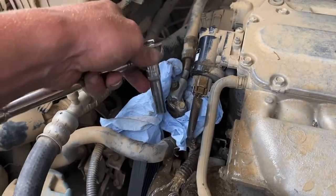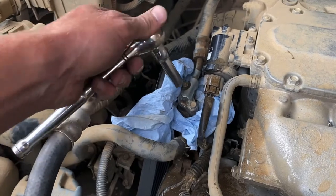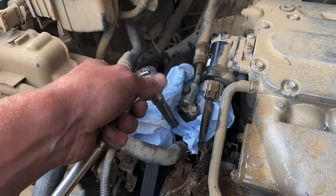Let's get this O-ring replaced — it shouldn't take long at all. Back to taking this off. I'm going to stuff a few more paper towels in there. This is a 10mm and you're just going to remove these two bolts and then get to that O-ring.